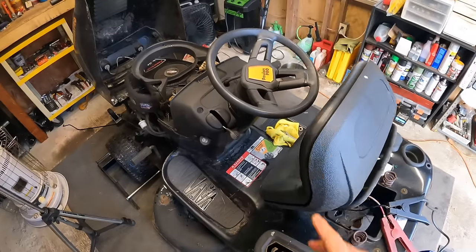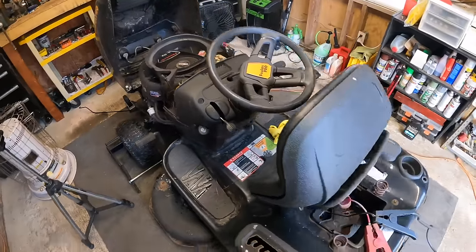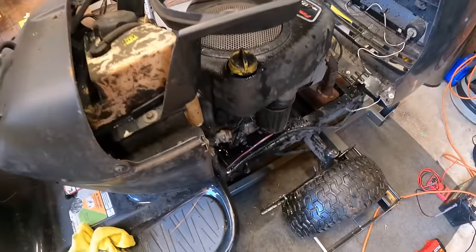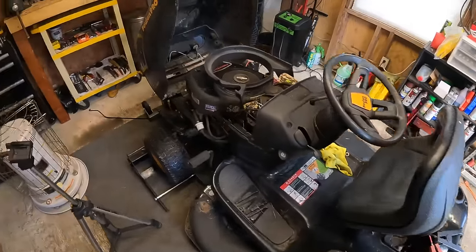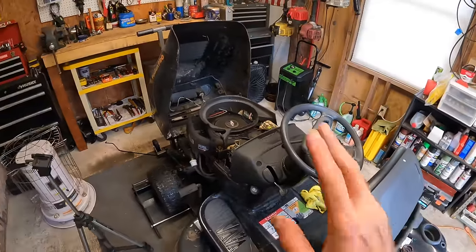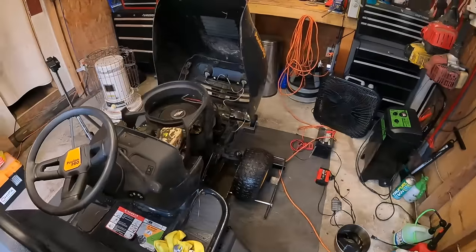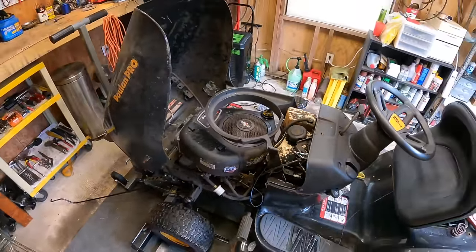It's only running on choke, so I'm going to try it a couple more times, cycling with the choke on to see if it'll start pulling fuel. Most likely those jets are clogged up. It's really stinky in here — this thing had a ton of water everywhere. So far so good — it cranked right up. It's probably been sitting at least a year or two. I'm surprised that Nikki carburetor was even running on choke. I don't think it'll run without pulling the carb off and cleaning it.